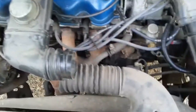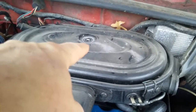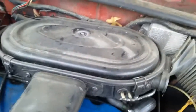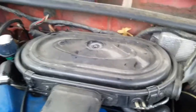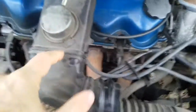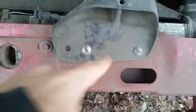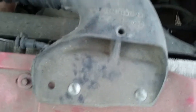For most of you, the airbox removal is pretty simple. You remove a wing nut or some sort of nut that's most likely been replaced on that airbox lid. Remove that nut and then you can disconnect the box at various points, or just undo the two bolts or screws, whatever is securing this first plenum.